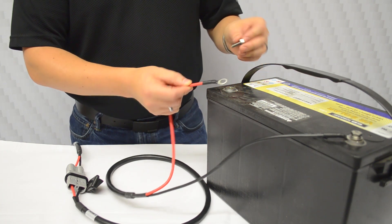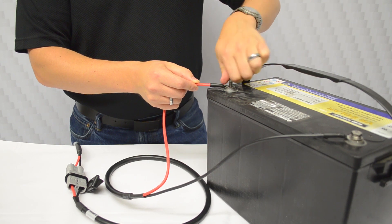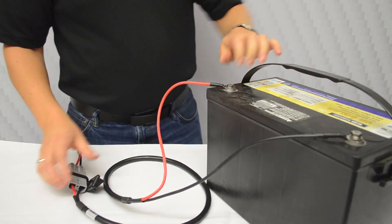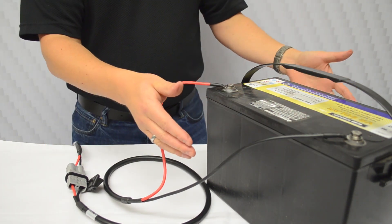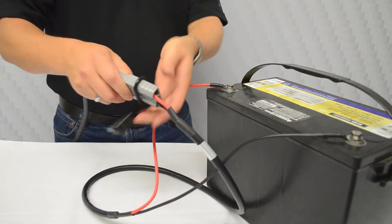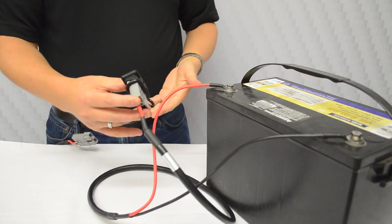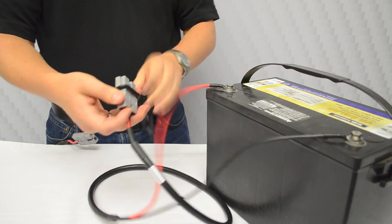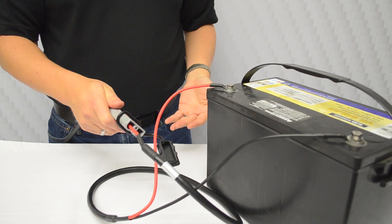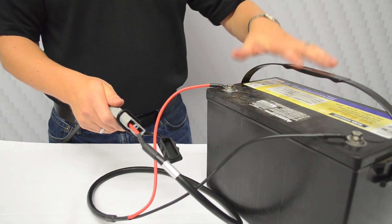Using the ring terminal connections — we have our ring terminals on. I always connect the negative first to get less of a spark from the battery. The reason you'd use the ring terminal is if this battery is in a cover or compartment where you can't easily access it. You can simply use the Anderson connection, leave it there, put the cover back on, and when you come to use your PSK, just pull the cover off, plug in the extension, and the PSK is charging the batteries. This is great in a fifth wheel where batteries are tucked away, or if you have a battery box and don't want to keep taking the lid off.